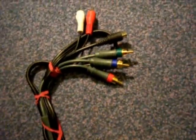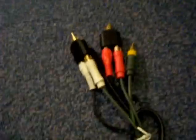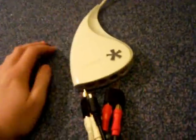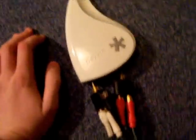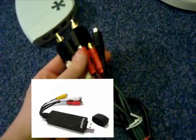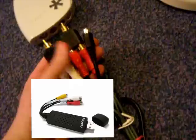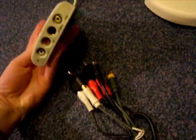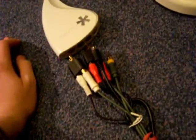Back over to the composite cables — I've got two Y splitters there for the two audio ones, that connects the two cables up. I've also got a USB capture device; mine is the Dazzle DVC-100. You could be using the easy cap or something. All you need to do is plug those cables into the Y splitters as shown, then plug it into your capture card, then plug that into your computer and you'll be able to capture it away.